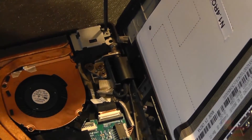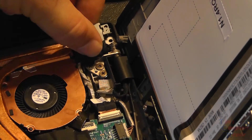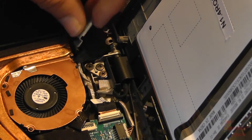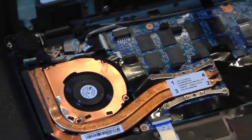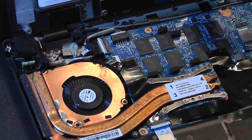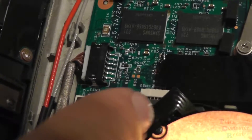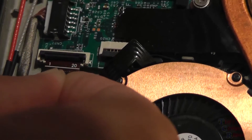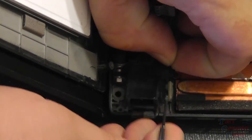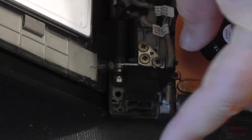There's one screw on a small metal cover that covers the power jack. We're going to take that screw off and remove that protective cover — no problem, it comes right off. That exposes the jack, and you can just lift up on it and it comes out of its slot. It's also got a little PCB connected to it. There's a ribbon cable that needs to be disconnected from the board that the power jack cable runs under, so we disconnect that. Here's a better view of the power jack.